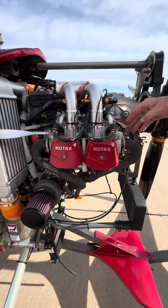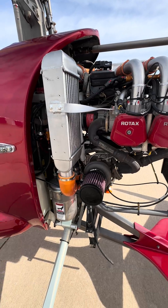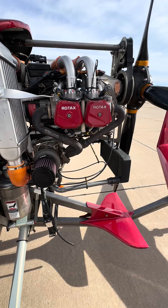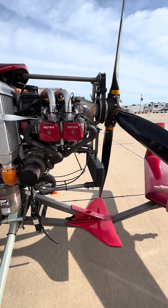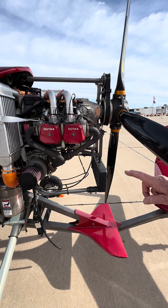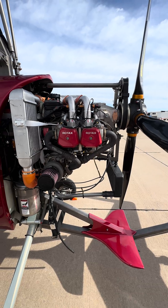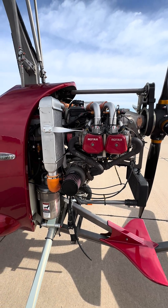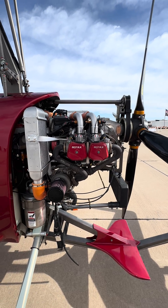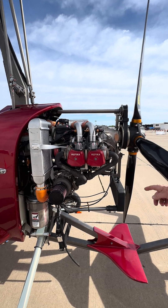Behind the heads on the cylinders, the whole engine is oil cooled. The lower radiator is the oil radiator and it's very efficient, so I tape it off — except for 100-degree days or when taking a passenger. I need to peel the silver block off, but I have to wait until 100-degree days before it would get too hot. So it doesn't have any coolant other than the oil — it's 100% oil cooled.